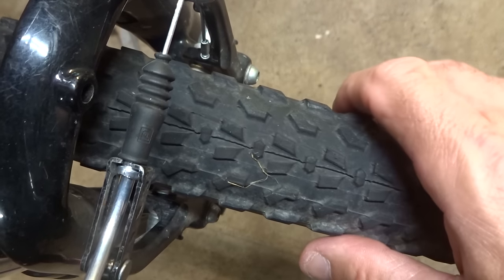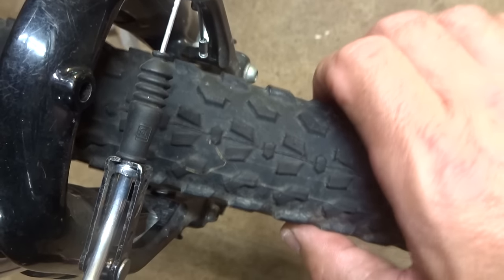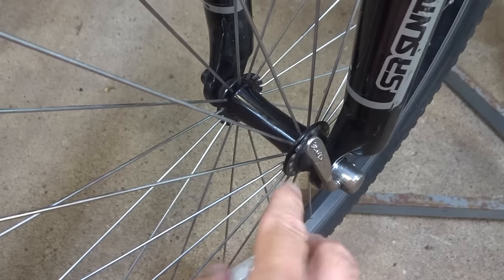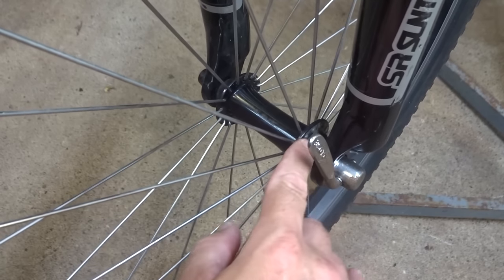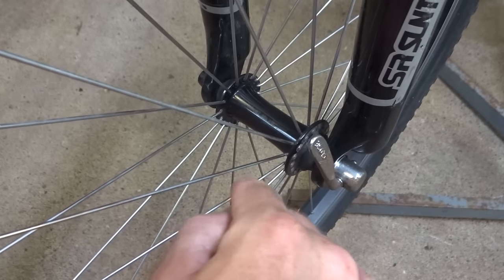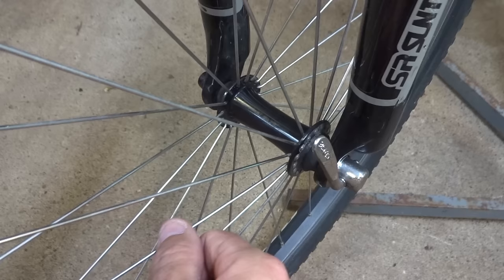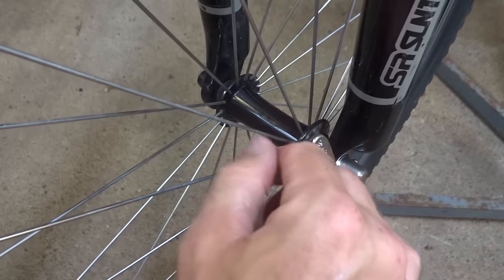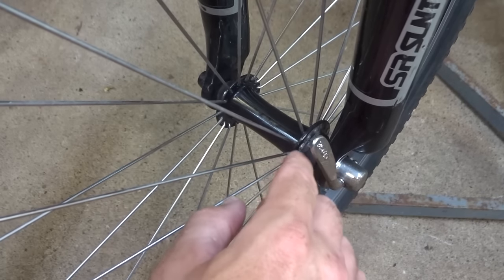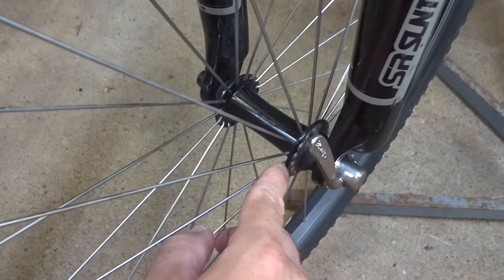I started to work on this bike that I just bought and check out this front wheel. It's very loose and wobbly so I'm gonna go ahead and fix this. My first guess is that the cones are out of adjustment, maybe the bearings a bit worn. Another possibility is that the axle in there is broken — it's unlikely but possible. So what I'm gonna do is open this up, check the axle, and if it's broken replace it, but most likely just a simple cleaning, lubing, replacing the bearings and getting everything adjusted should solve the issue.